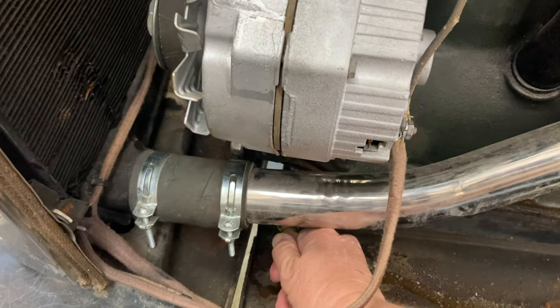Hopefully it's almost done — it's definitely a lot fuller than I thought. We're working on the third bucket and it's getting close to where I was swapping the other two. Trying to keep the micro cats away from the car because they're trying to drink this disgusting water. It's starting to get more rusty and disgusting looking, so hopefully that means we're nearing the bottom. If the petcock starts to get plugged, just get an appropriately sized screw, stick it in there, clean it out, and it flows again. I think we're down to small little drips.